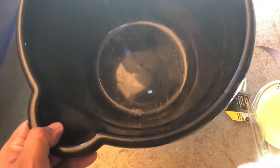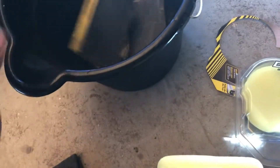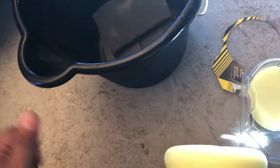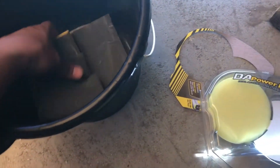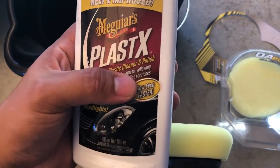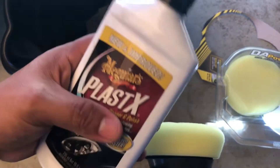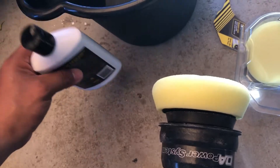You're also gonna need a bucket filled with water, 1500 grit, 2000 grit, and a scuffer just in case you're not able to get out that harsh yellowness. Start with the scuffer, move up to 1500, then 2000, and finally polish with the Meguiar's PlastX. If your lights are only a little hazy, you can do this with just the terry cloth and polish alone, or use the drill if it's a bit worse.